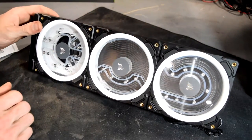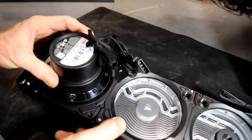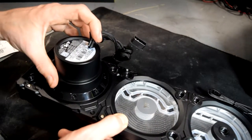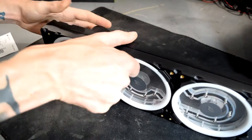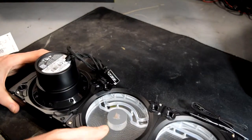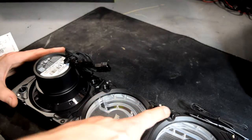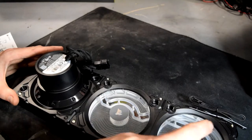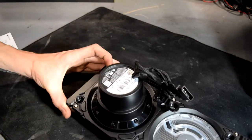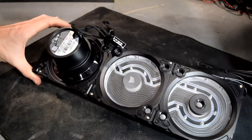This does look like a D5 pump, or at least a really similar pump to a D5. It's a Xylem D5. So great pump, interesting port layout. It says this would be your GPU, CPU, and then your radiator. Assume this to be your fill port, and you have two more down at the bottom for your drain. So we'll just have to figure it out as we go.